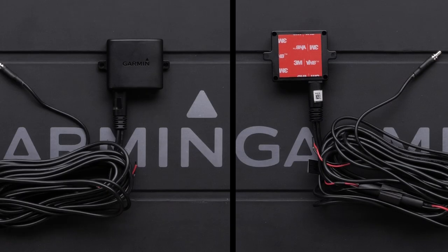Now, let's identify an area to place the transmitter. The location of the transmitter can affect the wireless range. The closer you install the transmitter to your Garmin automotive device, the better the signal will be. The signal transmits from the front and back surfaces, so place the transmitter in a way that faces your Garmin device. Dense metal, appliances, and solid objects placed between the transmitter and Garmin device will greatly reduce the signal. For larger vehicles, such as RVs and semi-trucks, placing the transmitter near or around an outer edge is preferred for best signal.